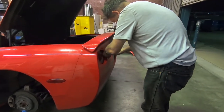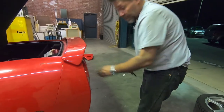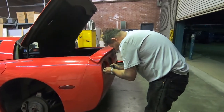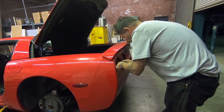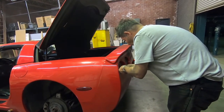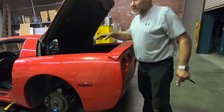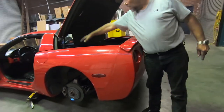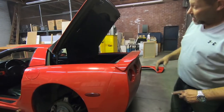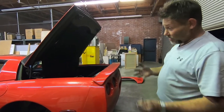If you're getting a fender from someone salvaging their vehicle, keep this in mind: if you have a coupe, you can only get a fender from a coupe. If you have a Z06 or a convertible, you can only get a fender from a Z06 or convertible. Between the coupe and the convertible they are not interchangeable because of where the top sits — the convertible has that extra piece that runs across the top that the coupe does not. Also if you're doing a wide body, make sure you order for whichever body style you have.